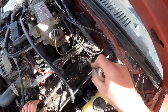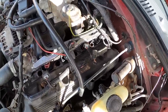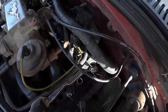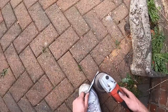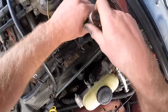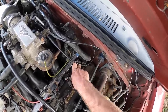I'm very intrigued to see these spark plugs — how old they look, and checking each cylinder to see if any are running rich or lean or if they all look the same. Shut up! What? Mate, what a steep — oh my god, the intake plenum goes right over the hole. I'm going to have to grind down a socket just to get a fucking spark plug out. Right, there we go, had to ruin a socket to get a fucking spark plug out.